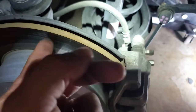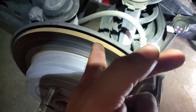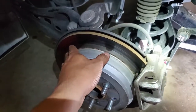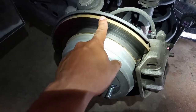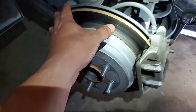If you want to inspect your brake pads, you can look at them without pulling them off. In my case these are pretty thick — I'll show a comparison to the brand new ones. You also want to feel your rotor; as long as you don't have a crazy lip on the edge you're fine. If you run your finger up and feel a huge lift, you either need new rotors or take them to the shop to have them turned, which means cutting them flat again. You can only do that so many times because the rotor has to stay a certain thickness.